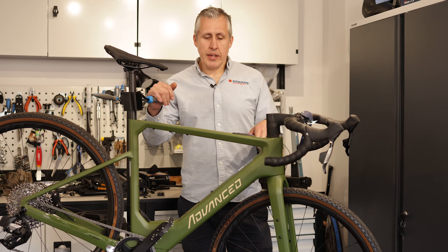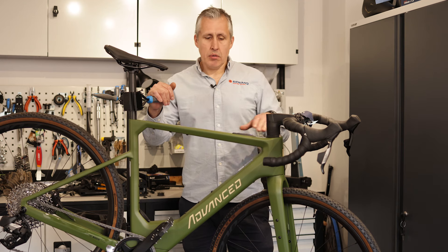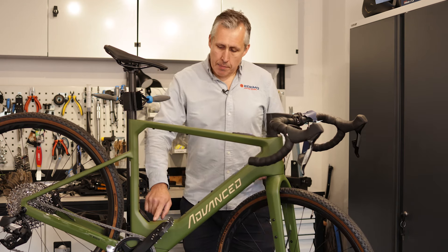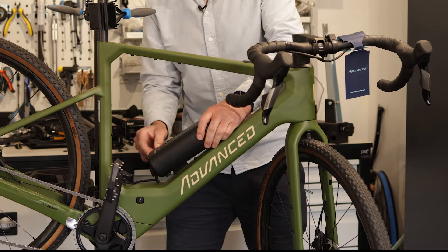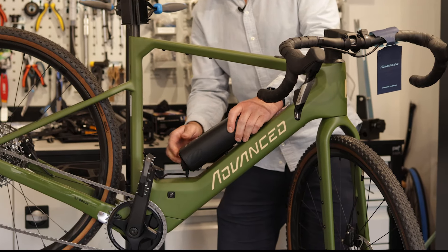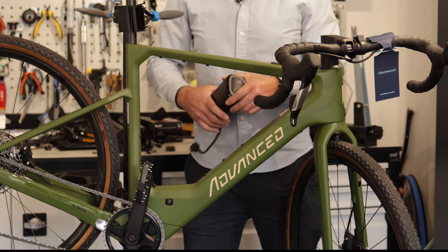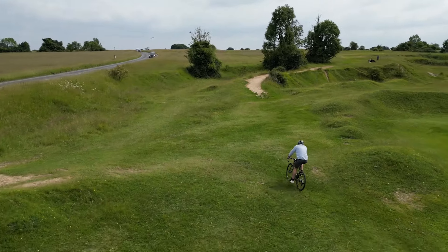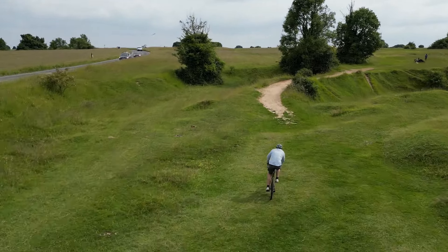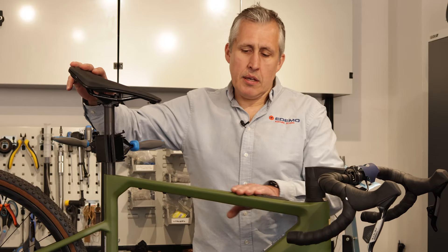Whether powered or unpowered, if you do run out of battery power you can still ride this bike all day long — it's so light. It's also compatible with the Bosch Power More battery pack, so you can plug a range extender in here and mount the bottle battery on the frame, giving you an extra 250 watt-hours. If you need more riding time and assistance in higher power modes, that gives you a maximum of 650 watt-hours — good for 65 miles in eco mode.